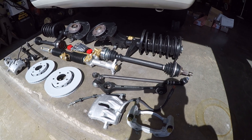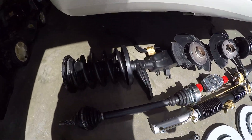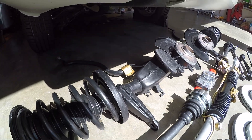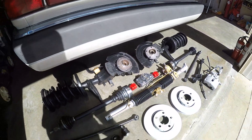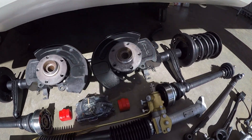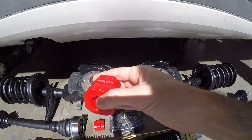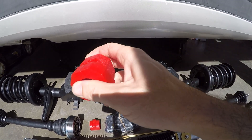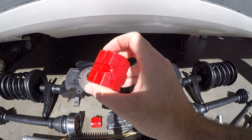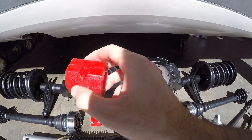So let's just go down the line here starting at the very back. I didn't really have to do much to this but I just cleaned it up and repainted it — it is the front sway bar. It was just a little bit rusty, a little bit greasy. And to go along with that I painted the shackles as well as got new polyurethane bushings because the old rubber ones were starting to get cracked and very loose. They don't make the original rubber ones anymore so I found these polyurethane ones and I'm hoping they'll fit up just fine.